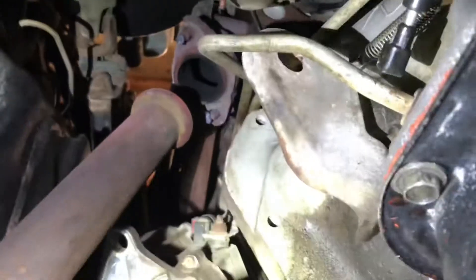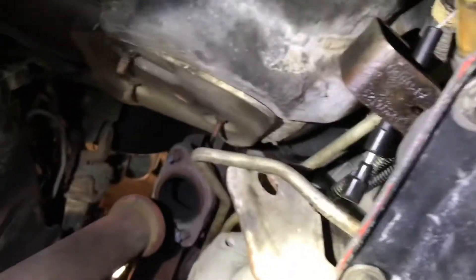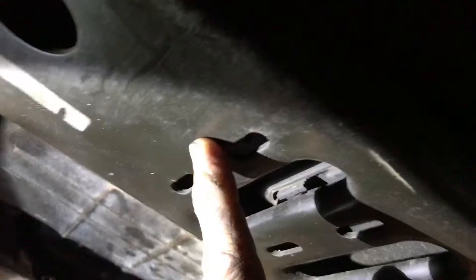This thing's a major pain. I had to get out the plasma cutter and cut some bolts off up there. Some of these bolts, man - trying to get the bolts out of the back side of that one was a major pain. I got one more bolt, and now that I have this loose I might be able to get to that other one. I'll take the crossmember off, take the two hydraulic oil cooler lines loose. I did get the starter off - the top bolt wasn't fun. The dipstick tube bolt at the top - if I didn't have the swivel head ratchet wrench, it wouldn't have been happening.